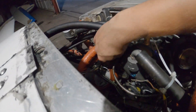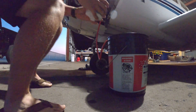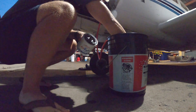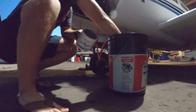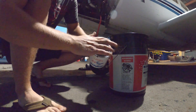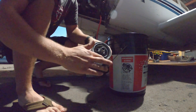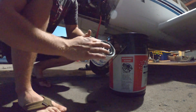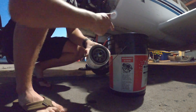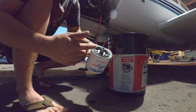We're going to get the rest of that lock wire out of there, and then we'll get the new filter in. The instructions on these filters do say to put these on dry — I don't agree with that. I almost always oil the o-ring of these filters; it just helps it go on and come off a little bit easier when you go to take it off. It's not going to leak or do anything crazy. It's obviously not going to come off because it's lock wired. It's just a very thin layer of oil on this ring — that'll just help it spin off a little bit easier when you go to change it next time.